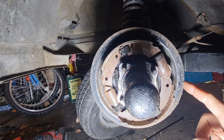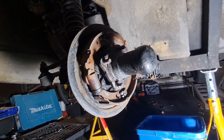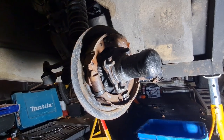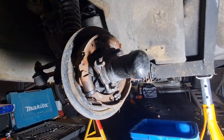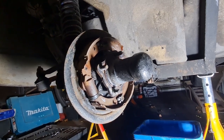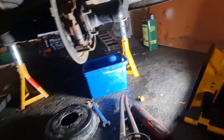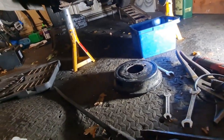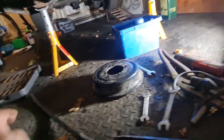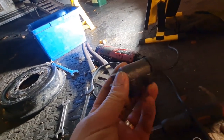My suspect cylinder looks like it's right - it's not moving. That bottom cylinder, the one closest to the left-hand side of the screen, squeezed back in no problem after having pushed it out with the pedal. The other one is absolutely solid - it won't move at all. As luck would have it, I've actually got in my box of bits a brand new one, and only one as well, so that's quite lucky.